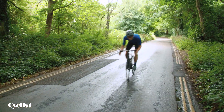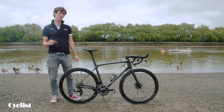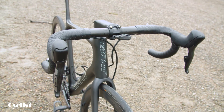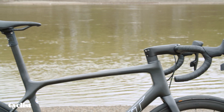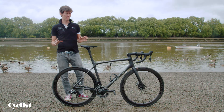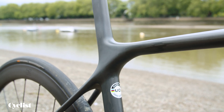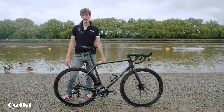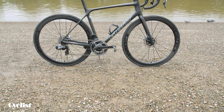It's 0.5 watts faster than the next fastest endurance road bike — though it's worth noting the newest Trek Madone came out just a few weeks ago, so we suspect the newer Madone is most likely quicker in the wind tunnel. In terms of weight, it is not quite the lightest on the market, but it is still lighter than the S-Works Tarmac and the Cannondale SuperSix. The whole frameset — fork, frame, and seat post — comes in at 1,266 grams, which is daringly light.